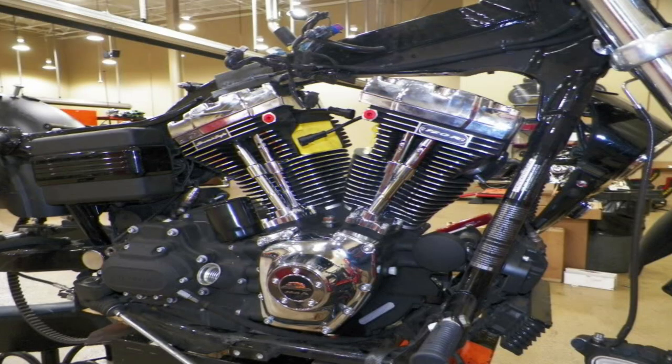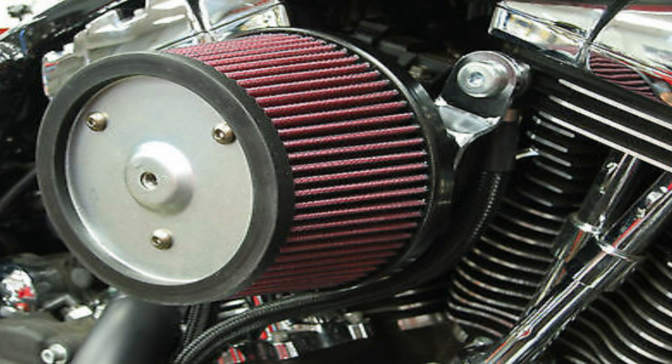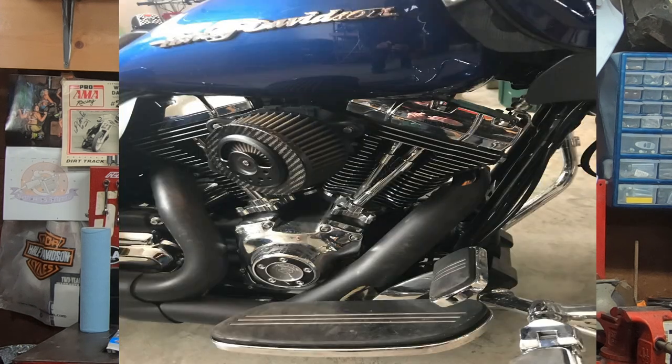If you're wondering whether air cleaners relate to horsepower — yes, they make a difference, but you really have to start getting into a monster motor before it matters significantly. Companies like Fuel Moto or S&S, if you look at the bikes they build, you'll notice their air cleaners are very plain-jane with a large open element and no fancy covers — just a little decorative end cap, but the element is left open and unrestricted. If you're doing cams, mild compression, and a mild big bore kit with a little head work, you can generally run just about any air cleaner you want.